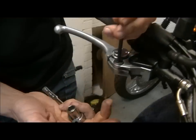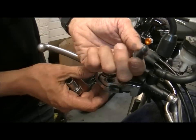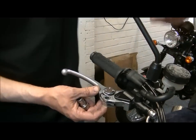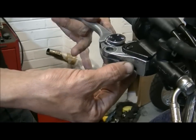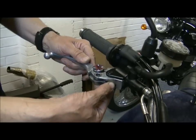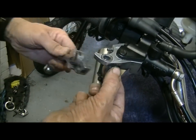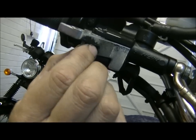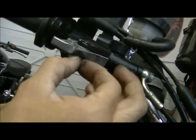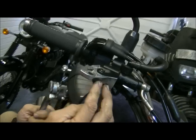You've got a little lock nut underneath which you just remove. Then there's a little oily post — it comes out there, it's like a little cotter pin. They're quite oily because they've been greased inside. Now to get this off, there's a little spring inside there. Before that spring goes ping and disappears into another dimension, the way of getting it off is: come down, come out a little bit so you're off the end of the peg, come down, jiggle 90 degrees — so you're hanging 90 degrees downwards — and then wriggle that off the end of the spring. The spring is captive in there but only by pressing it in; it's not welded or pinned or anything else. It won't fall out, but just make sure it's there — it sits in that little recess.